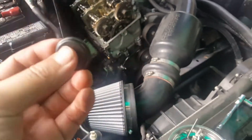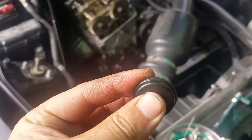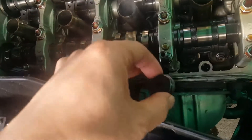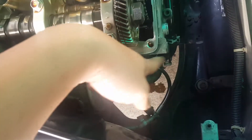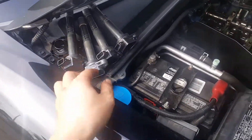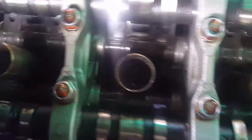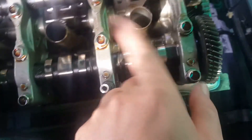Another thing I struggled with — I tried to remove the valve cover and it wasn't coming out even after removing all the bolts. The reason was I didn't take out the rubber seals around the bolts. Those seals don't completely hold the valve cover down, but they put friction on it so it won't come up. You have to take those out too. After that, I left the spark plug wires hanging and checked all four spark plug holes — everything looks clean and dry, no leaks.